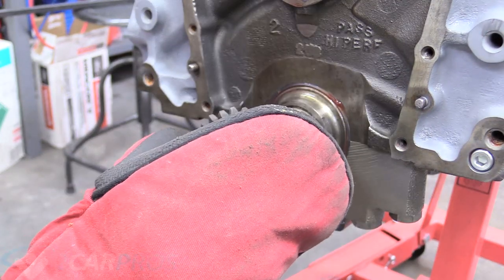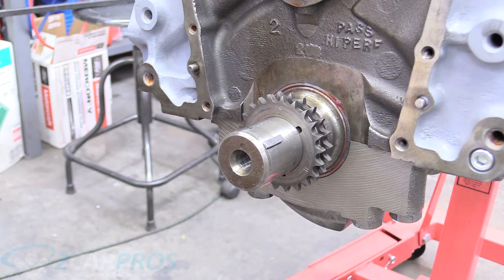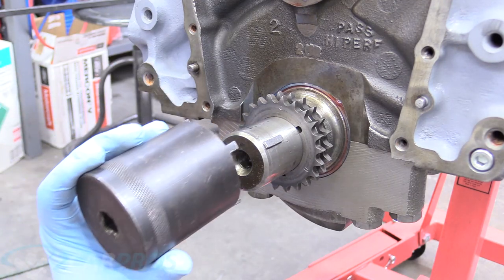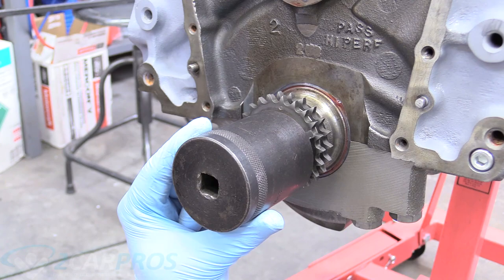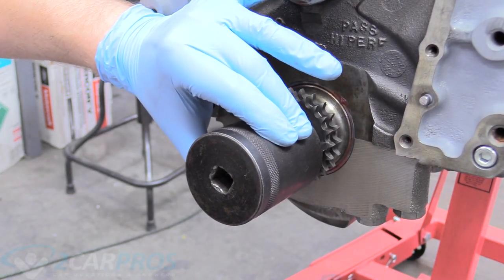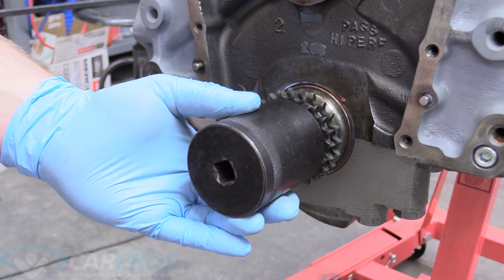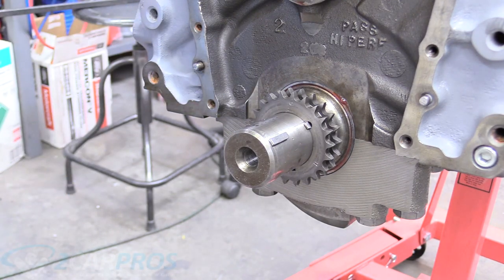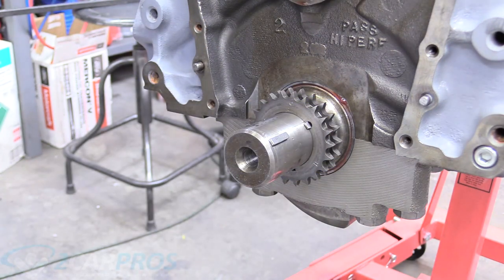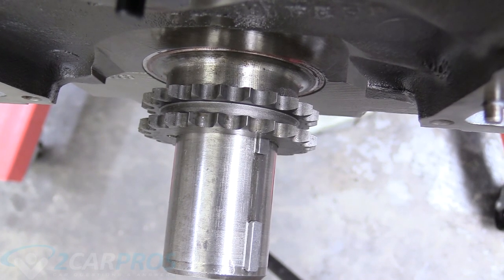Using an oven mitt, this thing is about 200 degrees so it's pretty toasty. We can slide it on past our Woodruff key and get it nice and snug. Then I'm going to take a really large socket — you can get these at any big auto parts store — slip it over the end of the crank snout, making sure none of the socket's points interfere with our teeth, and hammer it home. Double-check by seeing the zero at the top and the dome on your Woodruff key. You'll feel it go on and then give and then stop, meaning it's at the end of its travel. The harmonic balancer will really push it on when installed, so don't worry about it being perfect to the micron. There shouldn't be a gap between the sprocket and the beginning of the crankshaft.